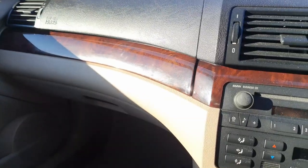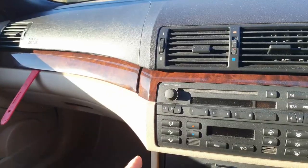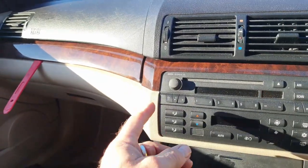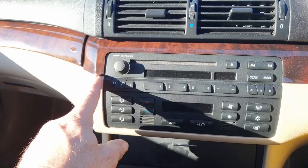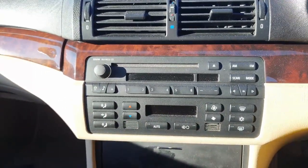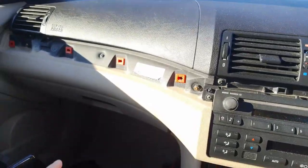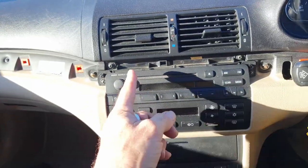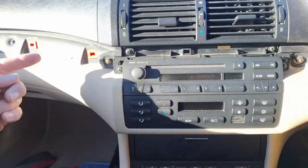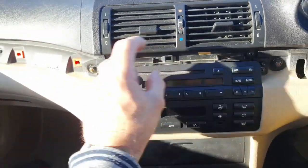I'm just going to go around the side here — try and do it one-handed, it's never very easy — and remove this trim, and also the second part. That should expose two Philips screws, one each side. So the trim is removed. Just make sure you start with this side first before you remove the other one, because you won't be able to remove this side — this one to the left just covers the little end piece there.